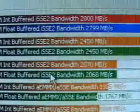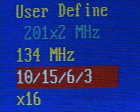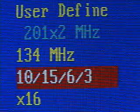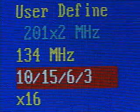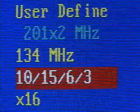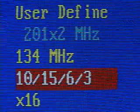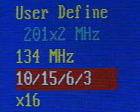For the OCZ AD 3200 memory, you will notice the settings are a little different. The true frontside bus is at 134 MHz, and the clock divider ratio is different than the settings used for the AD 3000. This is to show that I was able to get this memory above 400 DDR MHz. The reason for this is that I was not able to get my 1.6A above the 152 times 16 overclock, which is around 2.43 GHz.